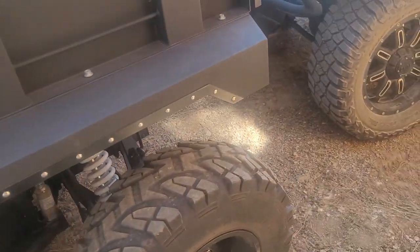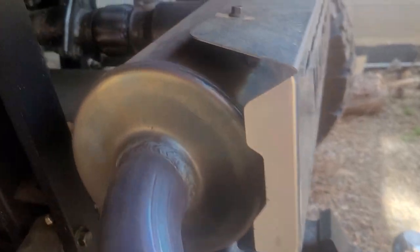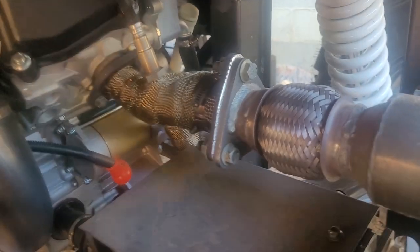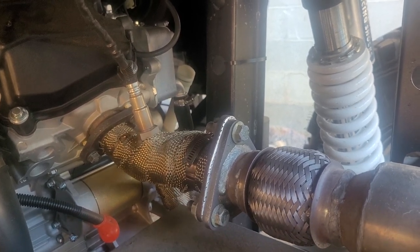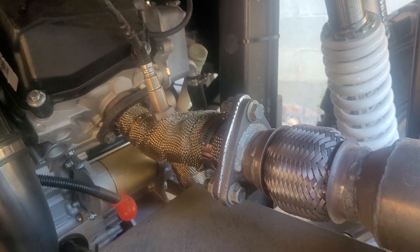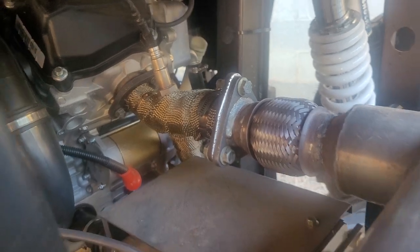So I'm waiting. And then he says if that doesn't work, I must take off the muffler. So now I'm working on a brand new machine — I've got to take off the muffler right here. There's a strainer, a screen, in there. He said because it was running too lean, it would maybe be clogged up. So now I've got to be a mechanic on a brand new machine that I just got two weeks ago and rode maybe once or twice.